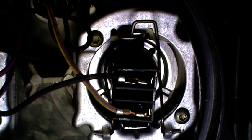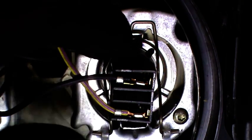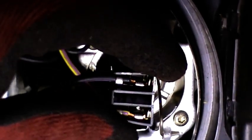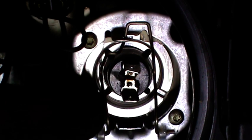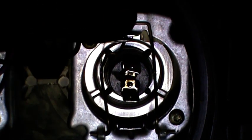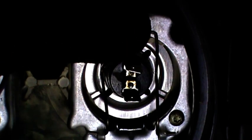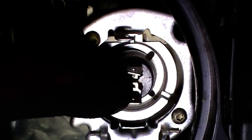I wanted to show you how the bulb is located, how you remove it, and how you check it to make sure it is a serviceable bulb. We're going to look at the dip beam bulb - it's nice and easy to remove. There's the two wire connection which simply just pulls off the back of the headlight using the clip, not the wires itself. You can see the two terminals for the actual headlight bulb, and it's retained by this metal clip at the top. You simply just push that in and release it to the side, and the headlight bulb is then released.